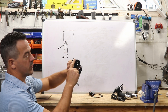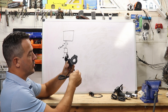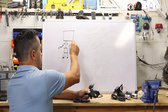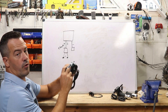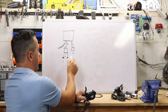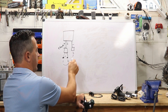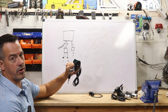This is a key switch with a voltmeter. I typically use this if I have a metal throttle, and the two conductors on here — green and red — are going to be this switch. You also need a negative connector to make the voltmeter work, so you're gonna have three conductors. These two are gonna turn your controller on, and this is gonna be the third to actually get that negative signal to turn your voltmeter on.